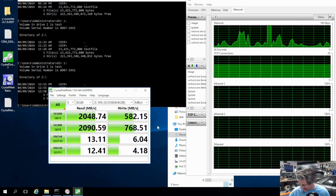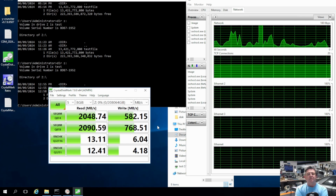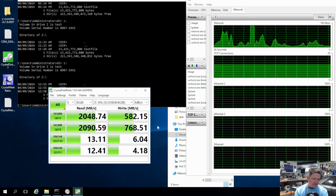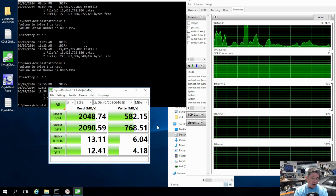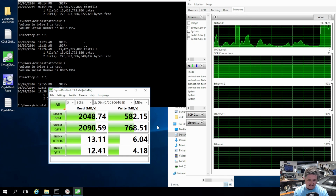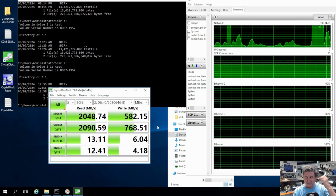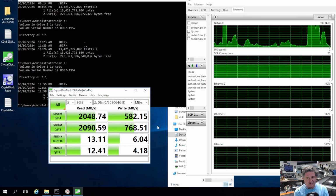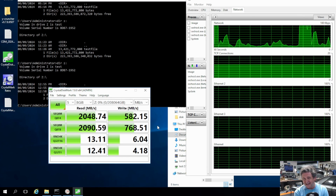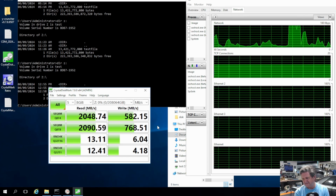The writes a little less. It was 5.6 before, and now it's 6. So that's somewhat similar. So random write performance didn't gain nearly as much as random read did. But overall, the performance of the array is better with the 3 vdevs than with 2 vdevs. And so in contrast to RAID Z3, it's nearly identical sequential performance, but better random performance, and not a huge difference in overall space available, 117 versus 113.